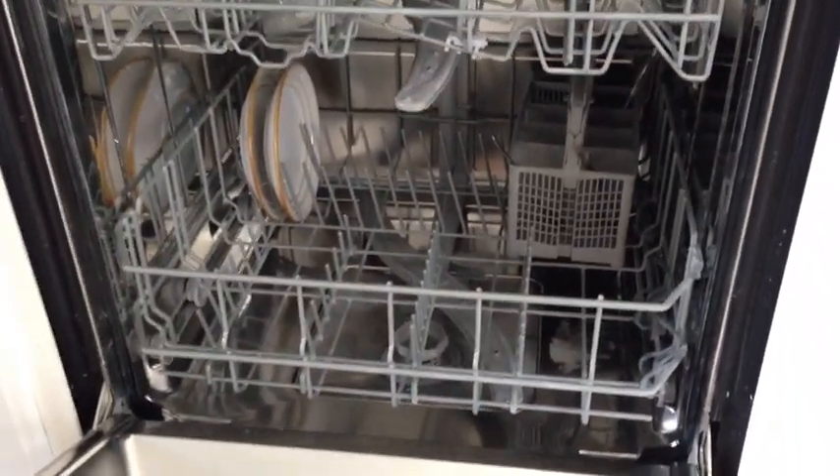All the Bosches may be somewhat similar, but the root cause of it leaking — and this is going to sound really weird — but on this particular unit, see that plug right there on the right? Some reports said it's on the left side, but on this unit it's right there on the right. If you're stacking something tall up, like maybe a cutting board or a tall plate or something like that, if it interferes with that plug, it's probably going to cause your Bosch dishwasher to leak outside the door.